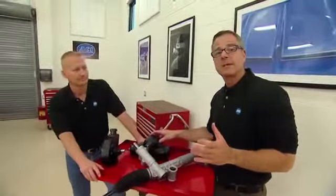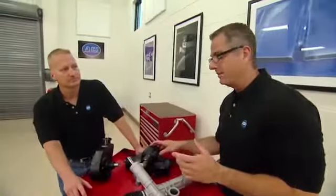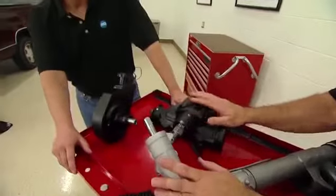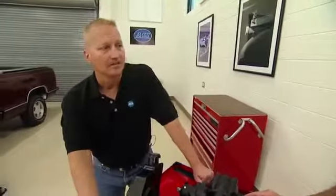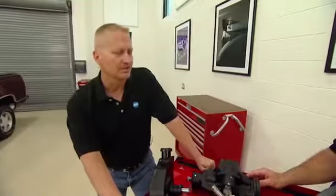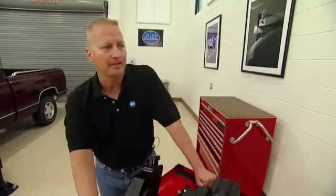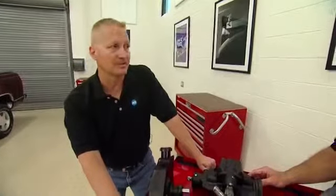You just heard it from Chase. And we have with us from BBB Industries a steering engineer, Mr. Mark Burkett. Mark, I'd like to ask you a few questions. What's the most common failure you find in a power steering system? Without a doubt, it's contaminated power steering fluid. As much as the pump is the heart of the system, the fluid is the lifeblood of the system. The fluid cleans, cools, lubricates, and conditions the seals in the system. It also helps transmit the hydraulic power to assist in turning the vehicle. It's important that you keep your fluid fresh so that you're not changing out more expensive components down the road.